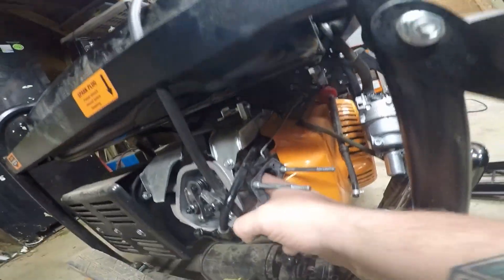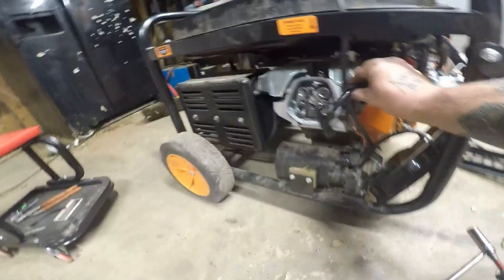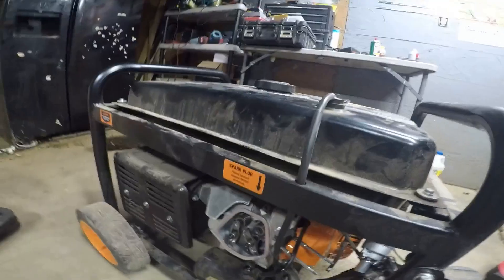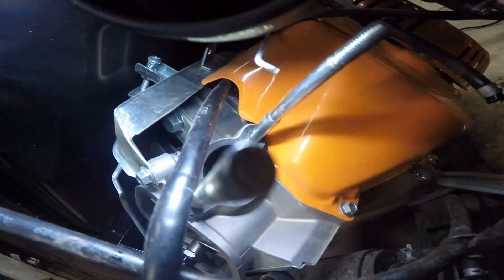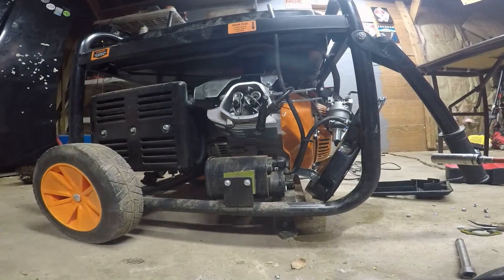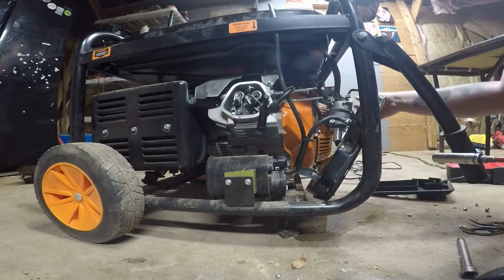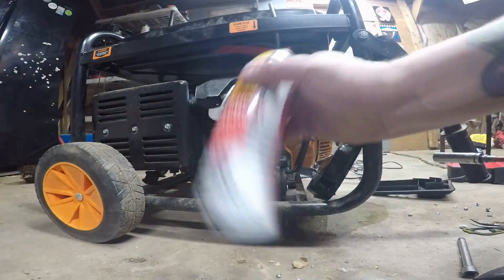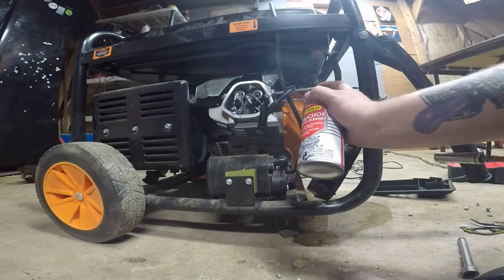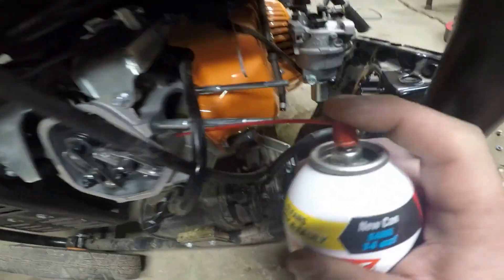Now that I have access, I can spray inside and get to that valve. You can remove this gasket here and access up in there. Let me grab this little light and shine it in there — take a look at that valve. I don't know how good you guys can see that, but it is a little gummed up. What I'm going to do is take carburetor cleaner, brake cleaner, or solvent of your choice and spray it at that valve — you'll see all the nasty stuff come out.